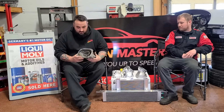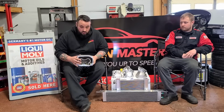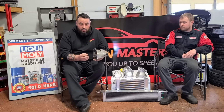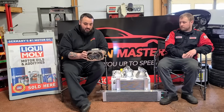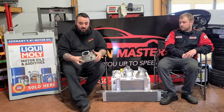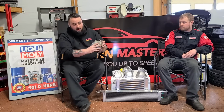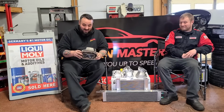So when you notice this, you have this giant bearing protector right here in the supercharger where this bolts up. This actually shields the bearings and keeps material from coming into them and keeps bearing material from coming out of it. And you can tell that is extremely restrictive. I mean, you can just look in there, very small opening here, for how big this takes up the majority of it. You can just imagine air coming in here and be like, slow! You know, no horsepower out of this one.